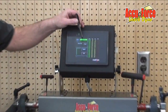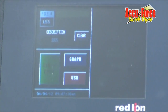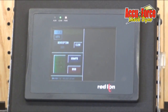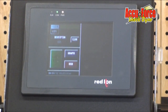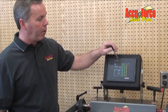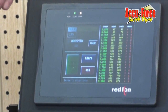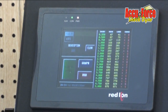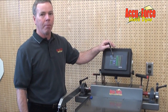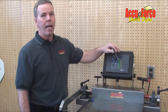For those of you that have a piece of equipment, the one thing I will tell you is this last run box, I'm going to run it here, you're going to see it change colors. It just changed to more of a yellow color from the green. Once we test a bar, because this is a touch screen that we use to make this operate, it's not like a computer, it doesn't have that much memory. You have to wait, like right now that's amber. If I was to shut this off right now, it would not remember this run. You have to wait till that box turns green for this to store that file. We could write it right now to our flash stick, but if we turned it off, it would not remember it. It is a 5-minute wait until that will keep this data in its memory.